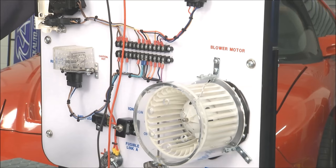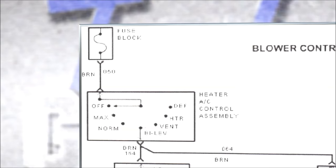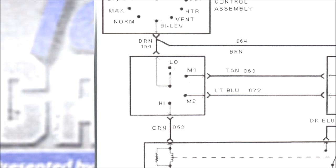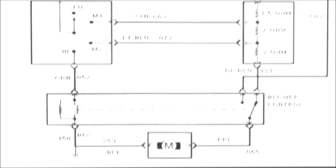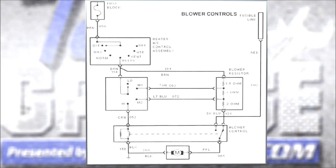Take a look at this schematic — we'll pull up a graphic. Modern schematics isolate the component, which makes them much cleaner than the old spaghetti diagrams. You can see it starts at the fuse, then there's the switch for on/off and vent, and here are the speeds. Then we go over to the resistor block, and down below is the high-speed relay. We're going to look at the purple wire going down to the motor and examine the voltages on all the actual wires.